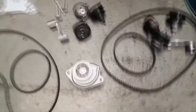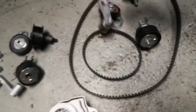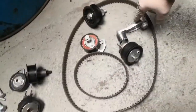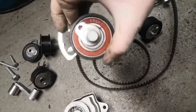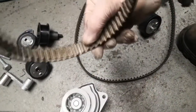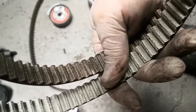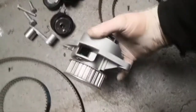Just a quick look at the new parts. That's the old tensioner, new one there — basically the same. Old idler, new idler — it's changed a little bit; the new one has a red cover on the bearing so they may have changed manufacturer. That's the old belt — doesn't look too bad in comparison to a new one, not frayed or damaged. And that's the new water pump.